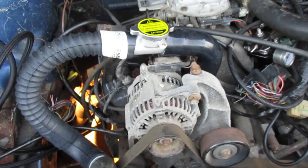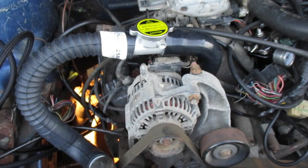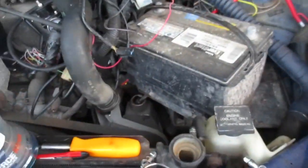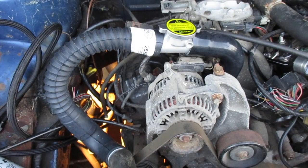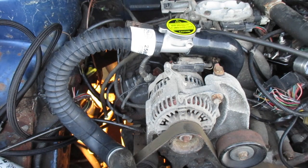And then I got this new spigot here hooked up. I got to get an 1/8 inch nipple thing for it, and I got to get some kind of a T for it, because I got to hook it up to the one that's over here, and I got to make sure nobody ever opens that, because that would be a problem. I think I'll put a higher pressure radiator cap in the lower radiator, and we'll put the lower pressure cap in the upper hickey, and then, oh yeah, I need to get some inch and a quarter through 1¾ radiator hose clamps. But that's not too bad. I can go to O'Reilly's and grab those.